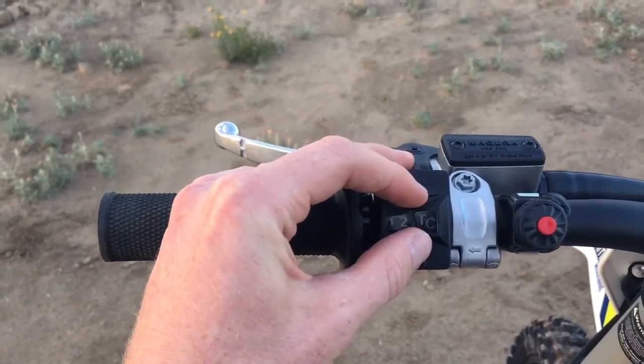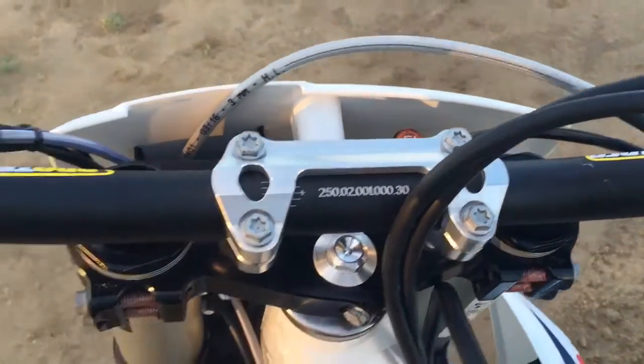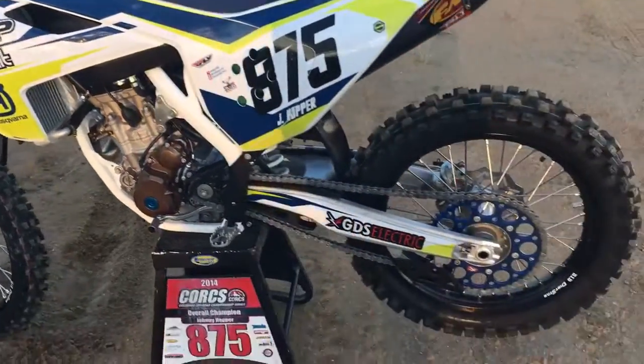What I'm doing here is if you hold both buttons down, it goes into holeshot mode, so that F1 is just blinking. As you're revving the motor, once it gets to a certain RPM it'll release, getting out of traction control once you're riding around on the track.